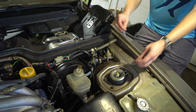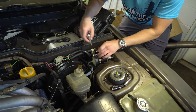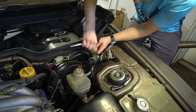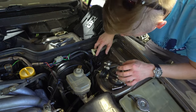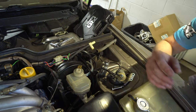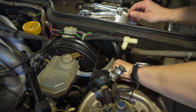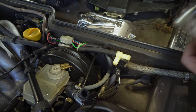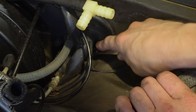These look small — 6mm. Those look like 12mm. We've got a flared wrench moment here on the top of the master cylinder — 12 millimeter on this flared fitting. Now we're going to try to sneak in and get these 12s off — maybe it's a 13.